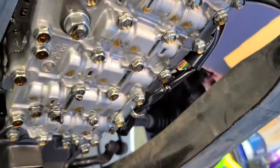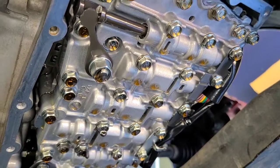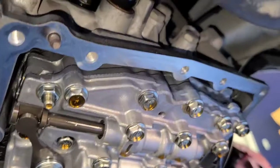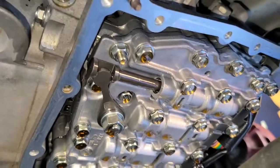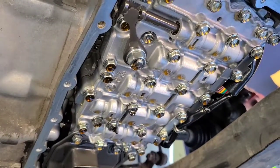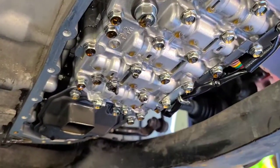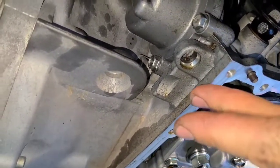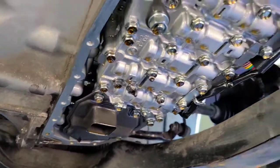There's the valve body. That's another thing you can swap out if your valve body goes bad. There's a couple bolts holding it in and you'll have to disconnect the computer and drop the whole valve body down. But fortunately I'm not having to do that right now. So we're gonna go ahead and drop the strainer, swap out the strainer, and make sure the bottom of the engine is nice and clean.